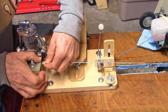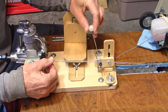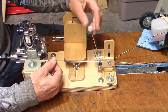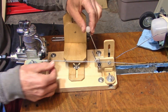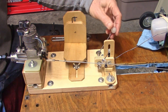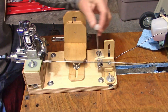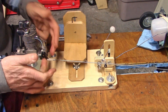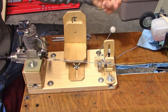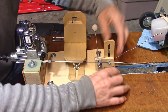This looks good here. The throttle adjustment isn't tight yet so I'm moving the throttle while also adjusting the stop position. I want my max position to be about right there, so I'm putting it down and going back. I'll push it forward just a little bit more. I'm not sure at this point which position is fully open and which is fully closed on this engine — I'll just have to put a piece of tubing on and blow through it to determine which is which.